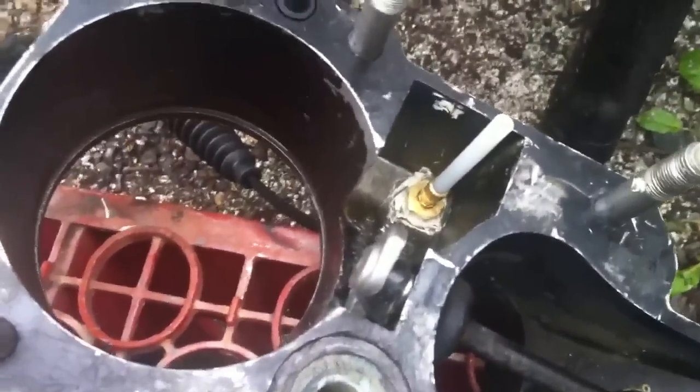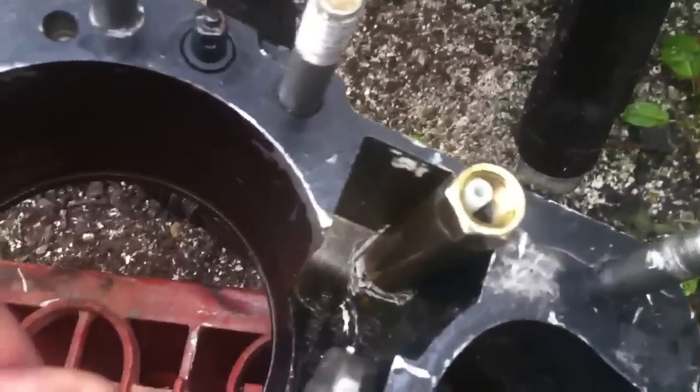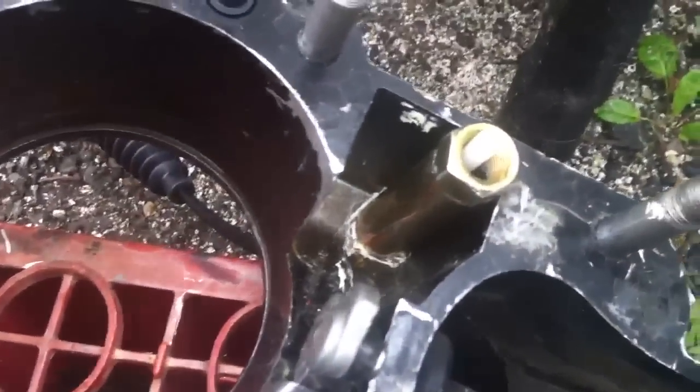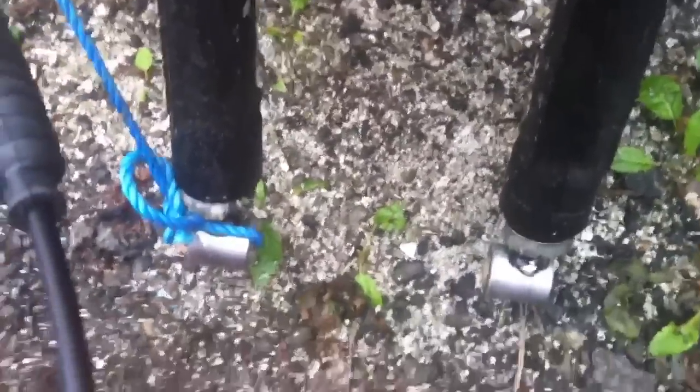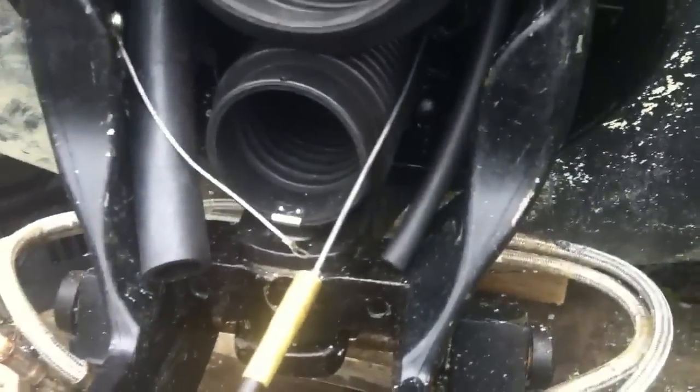Shift cable is now installed into the bell housing. You definitely need the shift cable tool - I had to send off to Canada for mine. That's the reason you need that length for the tool and it's got to be turned down if you use a normal socket - there's a plastic sleeve on the end of the shift cable. You could weld two sockets together as another option. When you tighten it up you need to leave two threads showing at the bottom. This is what I mean about the shift bellows - the brass end - you'll definitely not get through the bellows if it's been installed on the transom. It's got to be done off the transom. I'm going to tape the end up so I don't get any rubbish into the end of the pipe, then tape it to the end of my mouse and put it through.